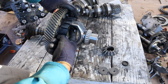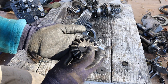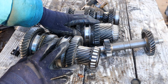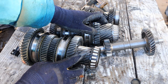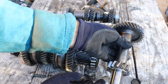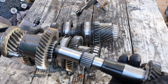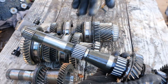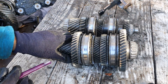Here's a look at the final drive — you can see we've got spider gears inside. This Volkswagen is a little different because it has a bolt that connects to the spider gears inside. Taking a look at output shaft one and output shaft two, you can see these have different gear ratios going out to the final drive differential. And here's that unique input shaft with one shaft on the inside and one on the outside, with needle bearings on the inside to keep it concentric.